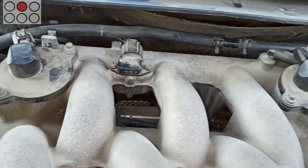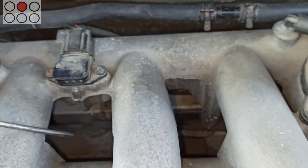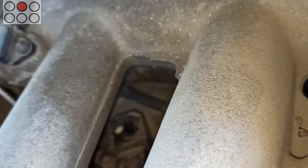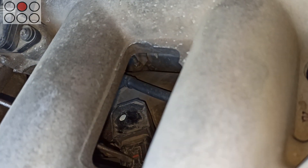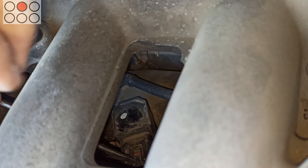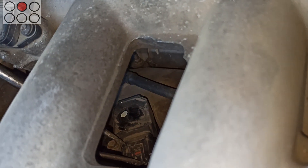In the top left corner of the screen you can see a scheme of the engine, so that you could know which cylinder I am working on to avoid misunderstanding. Because the backside cylinders on X-Type are officially numbered as the first, the third and the fifth — but sometimes they are referred to as the first, the second and the third.